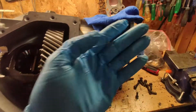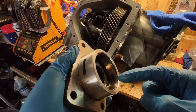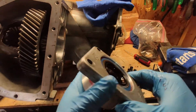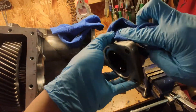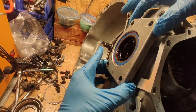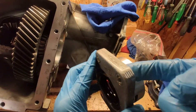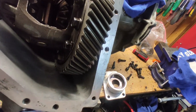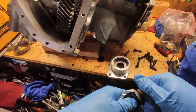It rotates, and in front you have this other piece of the bearing that goes on top right here — it has to go like that. Before you place it in, you want to change this oil seal. That's your drive shaft oil seal — same thing on the other side. We're going to place this one inside here like so. The manual says not to apply any sealant, but I will apply a tiny amount around here just to be safe, because I don't want to be changing this while it's on the car. I'm going to use an ultra black oil-resistant sealant.